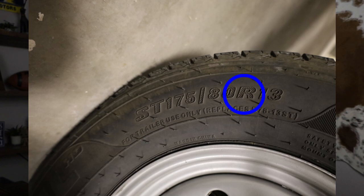Bias ply tires also give a slight advantage on load rating — not a whole lot, maybe 50 pounds or so on a comparable tire. I personally recommend radial tires because of their heat dissipation. I find myself driving my boat around in the summertime when temperatures are typically 100 degrees plus, so heat dissipation is extremely important to me. If you don't know whether your tire is radial ply or bias ply, it's pretty easy to find — it's usually the letter before the rim size. For example, ST 175 R13 is a radial ply tire; if it were bias ply it would say B13 — B for bias, R for radial.